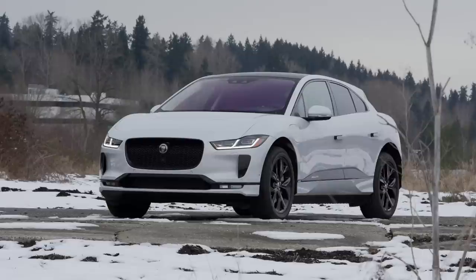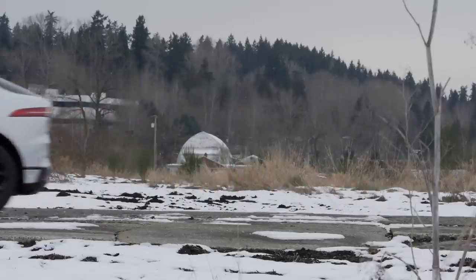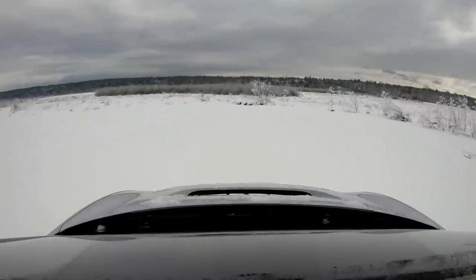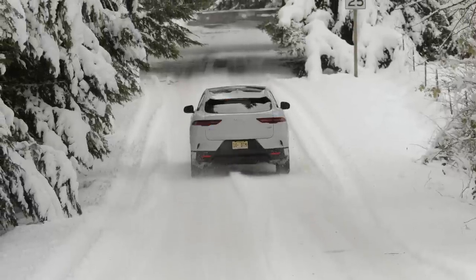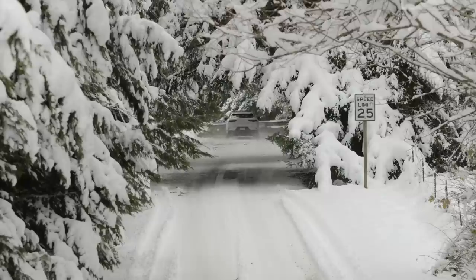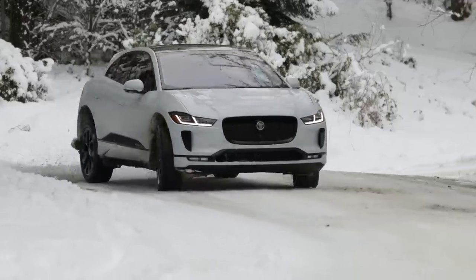Similar to Nissan's e-pedal, the iPace can engage heavy regen braking when your foot is removed from the gas pedal. If you do prefer to have the iPace creep like a standard automatic transmission gas burner, you can change the setting in the software. Be aware that range in stop-and-go situations will suffer since it can't collect a lot of that energy back. Whichever braking system you do select, it does stick to the key fob, so you can set it and forget it.